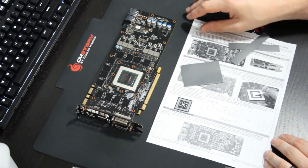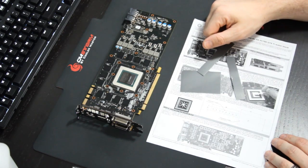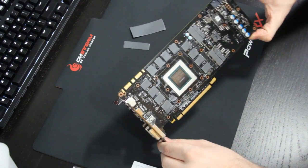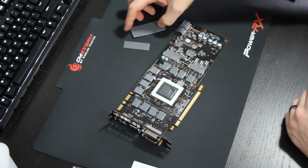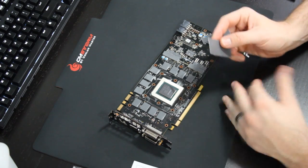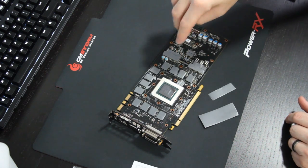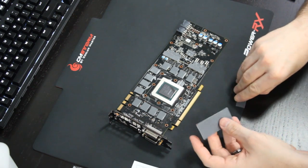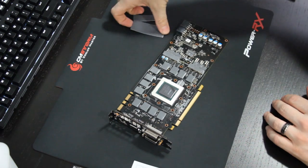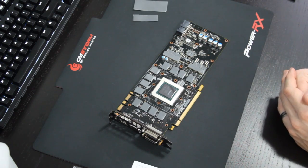The next thing is to figure out where your thermal pads are going to go. These thermal pads cool your VRMs as well as the chokes and the RAM modules on your graphics card, so make sure you refer to the manual that comes with your GPU block. EK is sure to give you plenty of thermal pads in case you make a mistake. I've got all the RAM chips, the VRMs, and the chokes thermal padded up with plenty of spares. One thing to keep in mind: thermal pads have two sides. There's a white backing you take off when you stick it down, and a clear film on top that you must remove — if you don't, you'll have thermal problems.